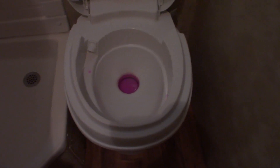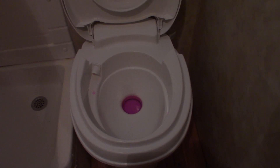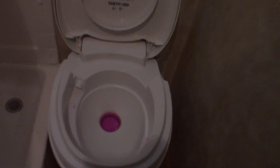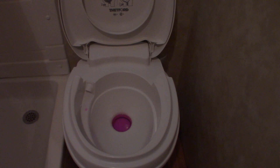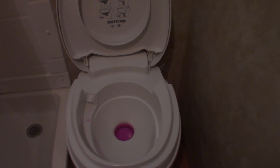This little bit of pink you'll see here and there is antifreeze — that just means it's winterized. The toilet — this is the flush lever here. You pull this forward to flush it. The black tank is directly below. You can't use a dry — meaning an empty — black tank. When you get to the campground, hook up your power and water, come in here and put one dose of chemical right in the bowl. Then pull the flush lever forward and let at least a gallon of water go into the tank below along with the chemical. You can use more water but not less. You want water and chemical in there before you start using it — otherwise the smell will be terrible and it can get clogged up. Never use it dry.